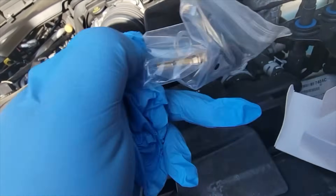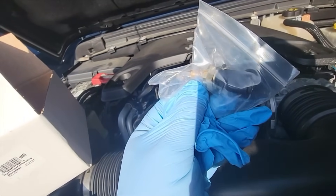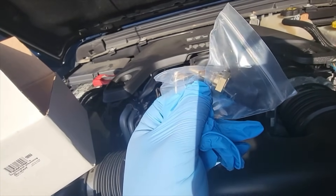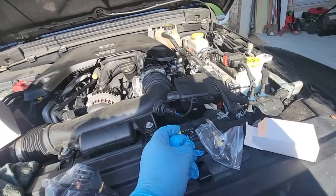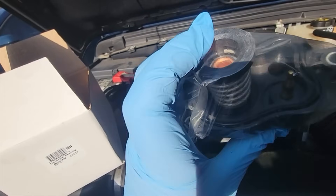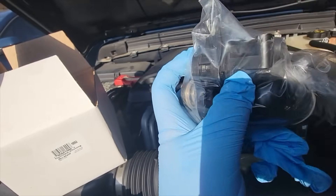Those videos can be misleading if you're not careful, because even the part numbers are not listed well online. This temperature sensor listed online for my model vehicle - which came out half-year in 2018 with the JK being earlier that year - actually goes to a JK, not a JL. On the JL model, your temp sensor is actually built inside the thermostat housing as well.